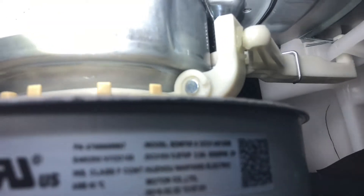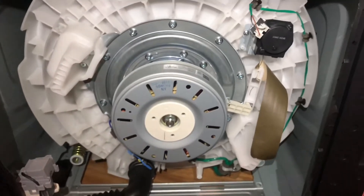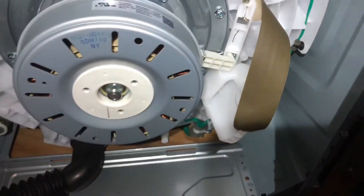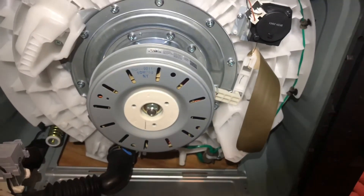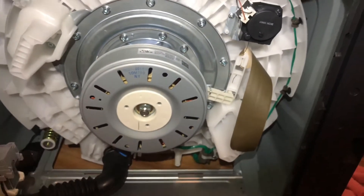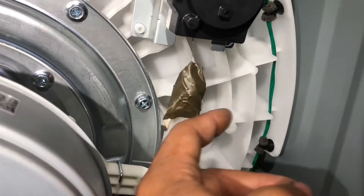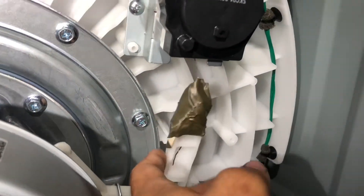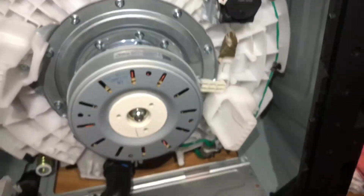That tiny little pull engages or disengages that lever right there — and that's what will cause your washing machine not to drain. You have to flip it upside down to see if it's connected. I'm used to seeing a lot of broken stuff, so as soon as I see something that's not matching, I go ahead and investigate a little more to find the part or fix it. This repair looks a bit overkill and wonky, but there's plenty of space for it to go up and down, and that should be more than enough to keep it in place.